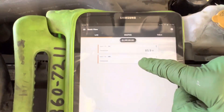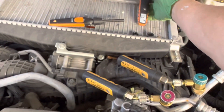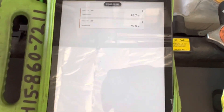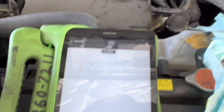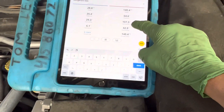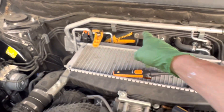Let's grab that — 251. We have 86 degrees going in as a liquid to our internal heat exchanger. Let's take that temperature sensor, which is at 86 degrees, and put it over here at our discharge line — this is the discharge line off the compressor. We will see that go up; we can see it going up right now. It's now taking the temperature of this hot discharge line. That 110 degrees would have been more of our liquid line outlet. Discharge pressure 142; our liquid line is 107, and that's our liquid line right over there going to the expansion valve, after it went through the internal heat exchanger.